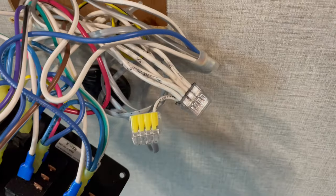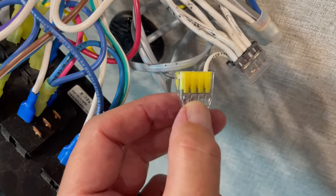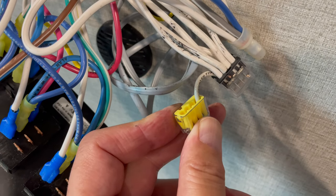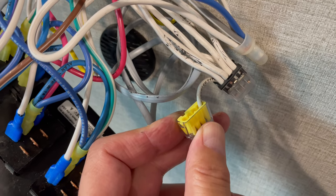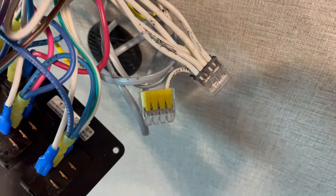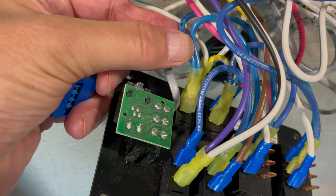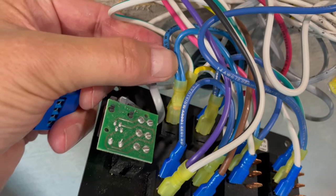The large wire nut has now been replaced with an 8-wire connector with a jump to a 4-wire connector, providing me a total of 9 possible ground connections. One is used by the wire going to the camper's ground, and 2 are used by the jumpers to add the 4-wire connector. We will be working with the ceiling light first, which in this video is in the top left position, bottom left when the case is mounted to the wall.